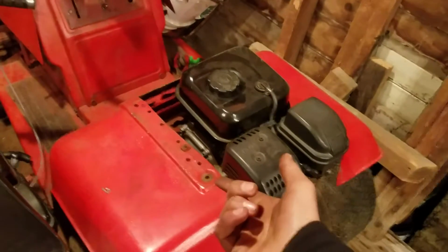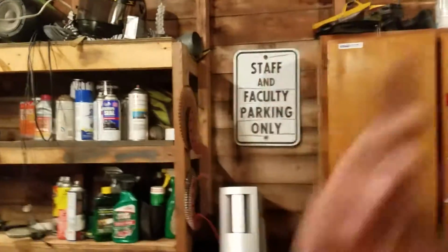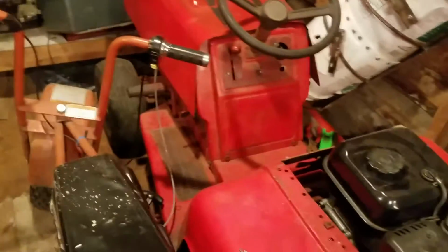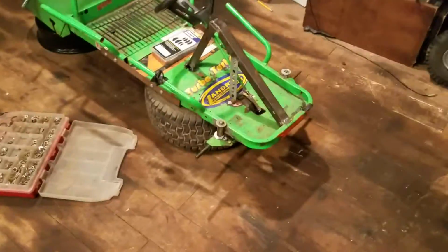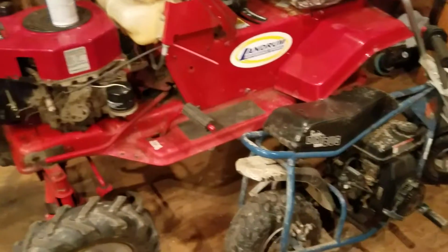Couple mini bike rides, this thing, once I get the rear axle figured out, I gotta just get another clutch. I gotta get a clutch with a bigger sprocket on it, which I have, I just gotta get it back. And I can throw that on and then get some 40 chain, which I have a breaker for, so this build's basically done once I get that clutch. No biggie. But until I get that clutch, we're done. This thing, I still got to get a carburetor rebuild kit for it, or another carburetor. No biggie, nothing's too bad.